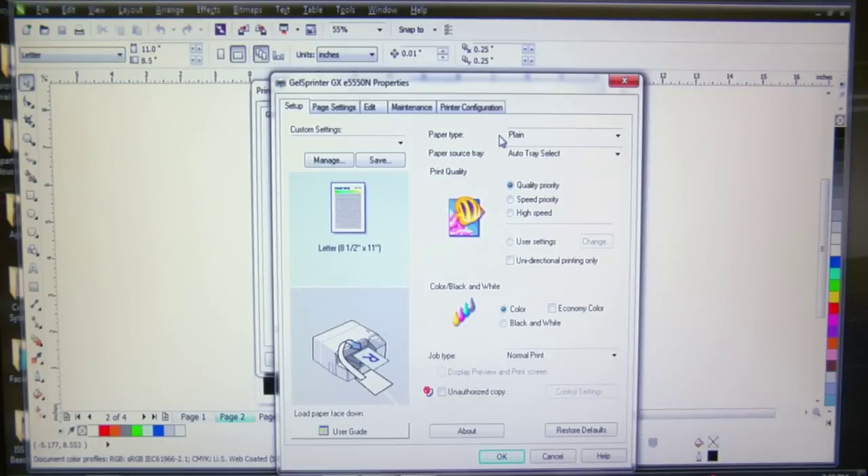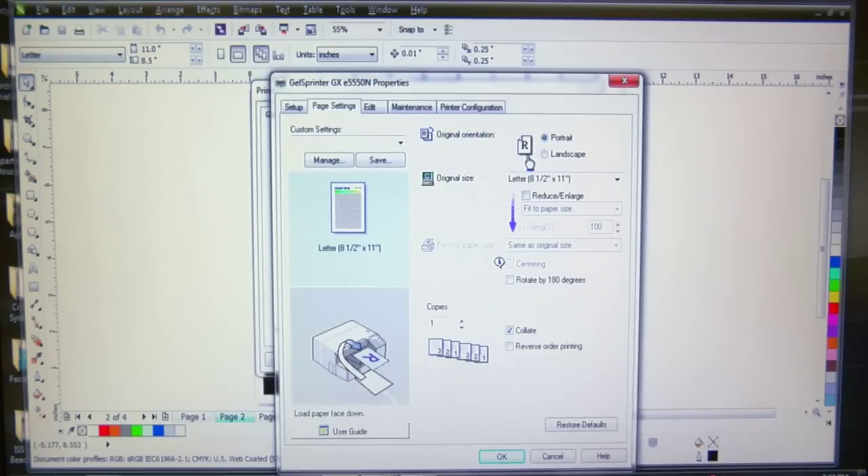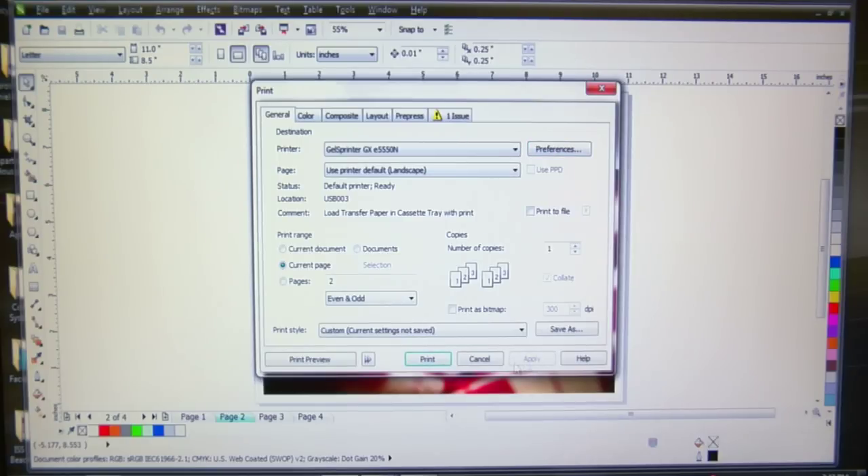You might have to do some testing depending on your individual inkjet printer. Most printers will default to a speed priority or text mode, but if your printer has a photo quality mode you want to switch to that. The other change to make under the page settings tab is to change the orientation — my driver defaults to portrait, but since this is a landscape image I'll change it to landscape. These are the only real changes needed to print to Neenah Jet Opaque II, so I'll click OK and send the graphic to the printer.